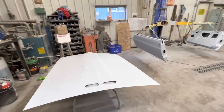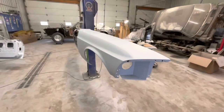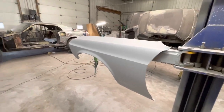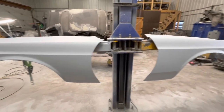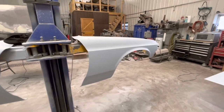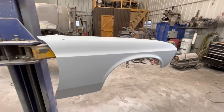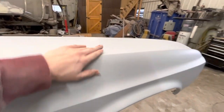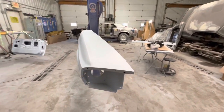Welcome back. It's been a couple days of sanding and priming off-cam. I got the front fenders primed - I did the same thing on the fenders as I did on the other panels: one coat of epoxy, four coats of 2K primer. The 2K primer is a high-build primer but I reduce it so it lays a little bit smoother, and also thinner, which is why I gave four coats - it's probably equal to about three unreduced. It lays really nice, so I've been able to go over everything with just 600 grit instead of needing 400.